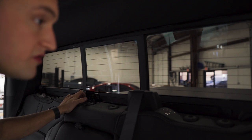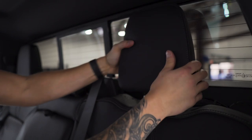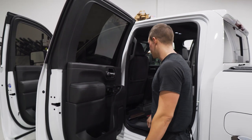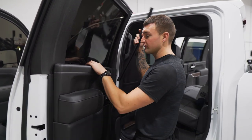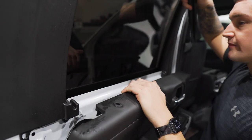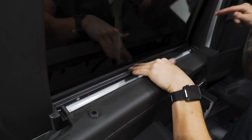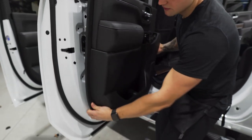The back windows look very uniform and there's no fingers popping up, so go ahead and pop the headrests back in. Now that all the windows are done and the bottoms aren't popping up with any fingers, we can reinstall the gaskets and door panels. Since we pulled the whole panel we just hang it on top of the gasket, so install the gasket first. Pull back on the top of the panel to release it, lay the gasket back into place — it goes under these little grooves so you'll have to bend it to get it under those.